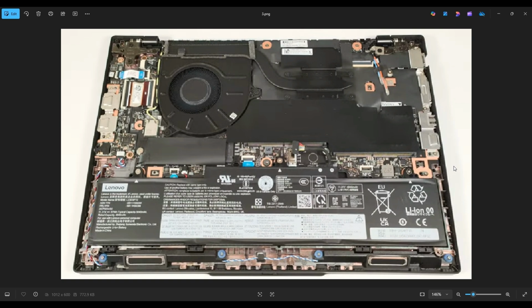And I guess the last thing to mention about this kind of operation, if you are here because your laptop is not turning on, your battery could be bad and you may need to replace it. However, most laptop computers should still turn on and function with a bad battery as long as the charger is plugged in. So if your computer won't turn on even with the charger plugged in, there could be something else wrong. I will have a video tutorial link above and also below in the description. It'll show you the troubleshooting process to find out why a laptop is not turning on and how to fix it.